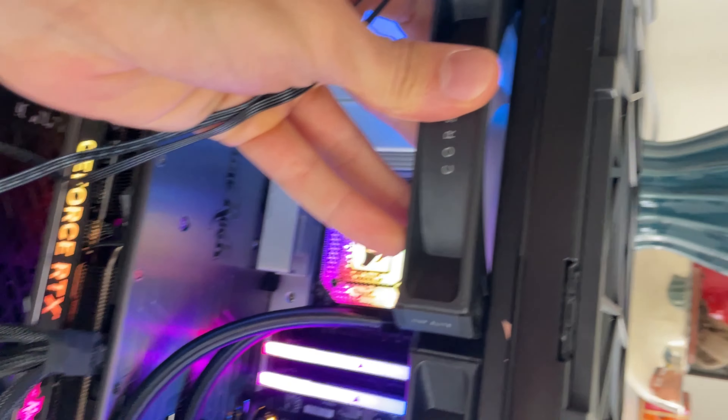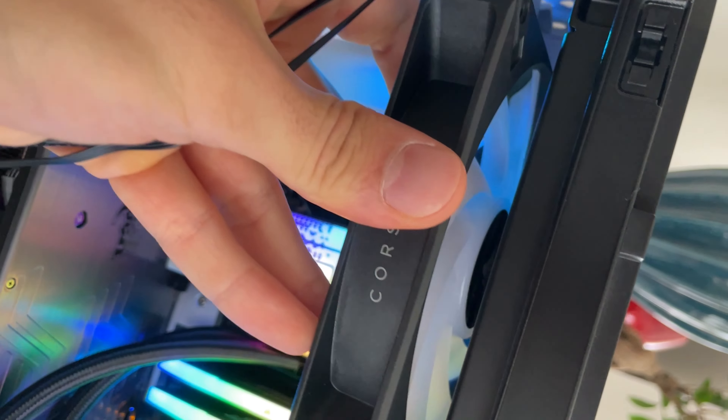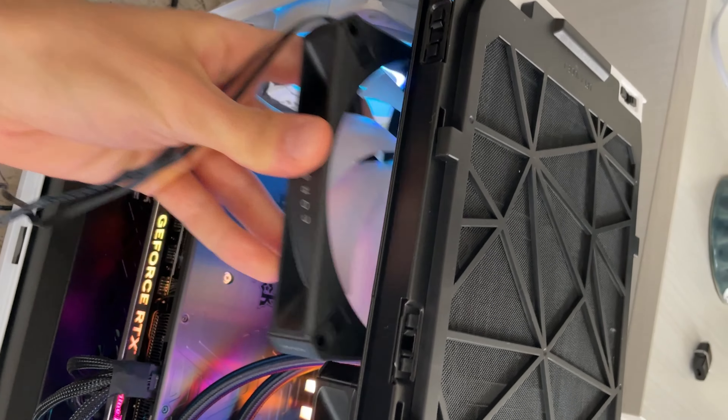So we went ahead and slotted the motherboard in, slotted the GPU in — the RTX 4090 fit perfectly. But the case turned out really full, and it wasn't possible to put the all-in-one in. Why? Because the motherboard — this beautiful white Aero-G board — has those white VRM heatsinks that interfere with everything. I placed the all-in-one on top and there was just no way to make it fit.